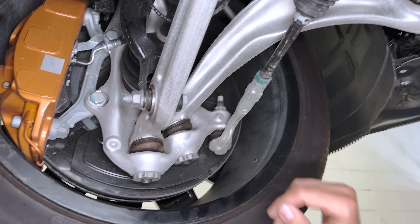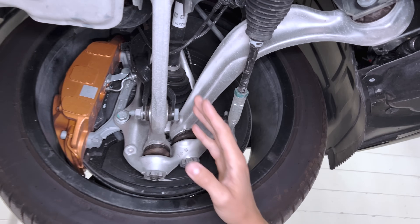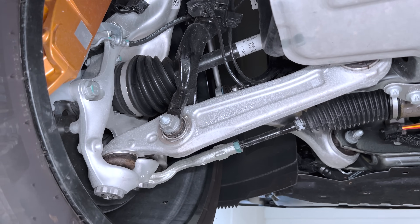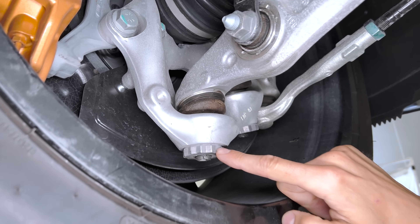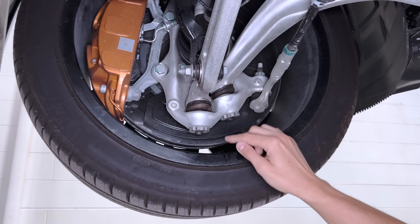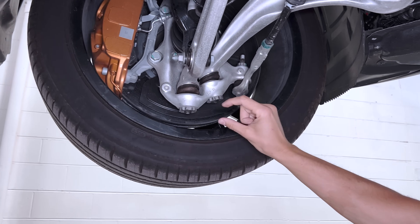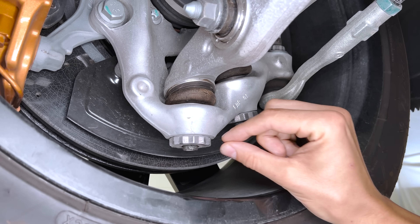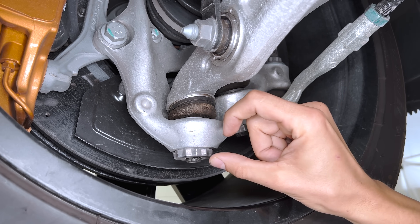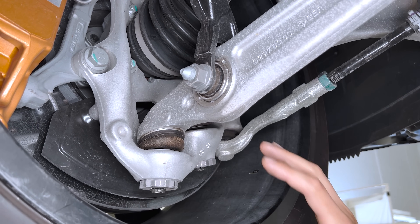Looking at the suspension, virtual ball joints are standard on this price class of vehicle — everything is forged aluminum: tension link, lateral link, upper control arm, and knuckle. Almost everyone uses a conventional nut on ball joints, but this design is more compact. The nut interface is actually inside the knuckle — it extends into the knuckle for proper thread engagement, sinking in for a very compact design in this area.